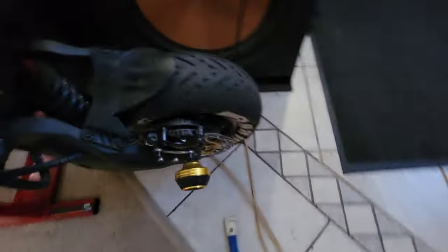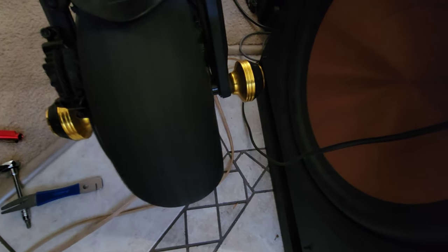Turn this back on and watch the tires — you can see the tires are naturally just crooked, they bend and wave around. That's what you're going to get with tires from almost all electric scooters. PMT tires are usually the gold standard. These crooked tires contribute to the brake chatter because once you get up to speed, the waving intensity of the tire will naturally move the rotor around.